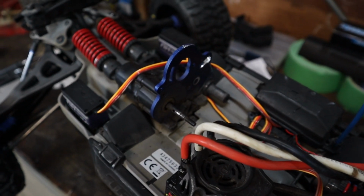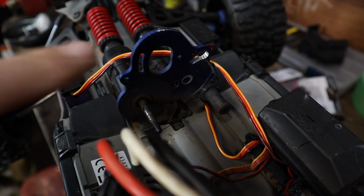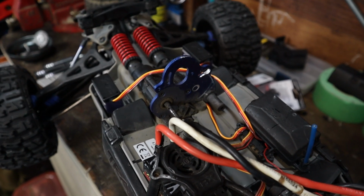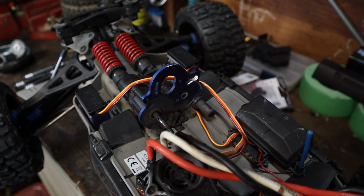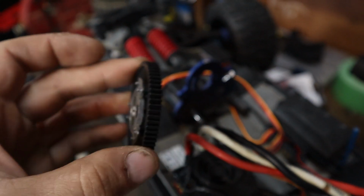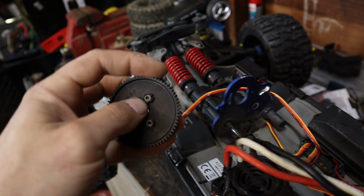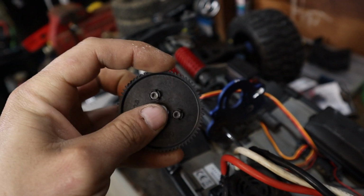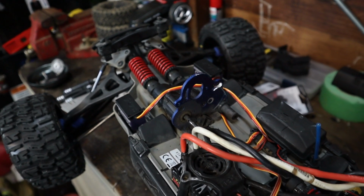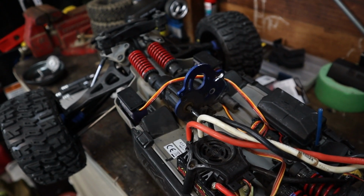But while I was in here, I already had to grind away, as you can see, on that ear right here, to try and make up for that bigger spur gear. And I think that's also led to more flexing, and that's why this ends up happening. It's only on not even a quarter of the gear, from here to about here. So I want to think it's just under that high torque load. It flexes and pulls away and just starts stripping the tooth.